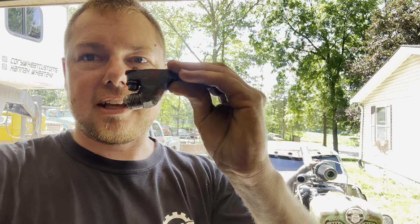So I think what the problem is, when I put the lower drain tube, you have to have oil going into the top of the turbo, and then it has to drain out the bottom. Well, I made this little thing here, and I think that's the problem. I think it's not draining quick enough, and the oil is seeping up and then out the intake side and out the exhaust side. So I guess I'm going to go back to the drawing board, and I've got to figure out something quick because now it's 3 o'clock.